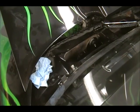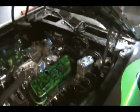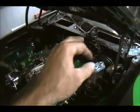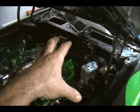Low. I'm going to put it into park. Boom, it's parked. Alright, so that's it. That motor's working. Now I think the washer pump, that broken piece of plastic, that clicking you're hearing, could be one of two things. Either the coil's not engaging and pulling that out, or it seemed really stiff, or it's frozen and it broke in there. That's why we had that. It probably broke off in there and went into the gearbox below and just wreaked havoc on the pump motor. So we have that working.